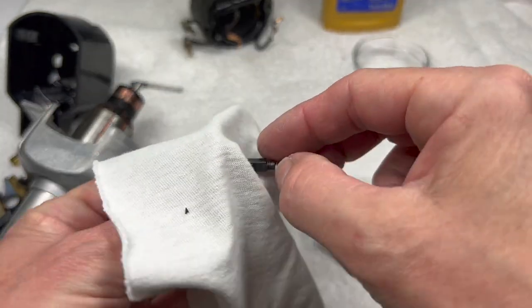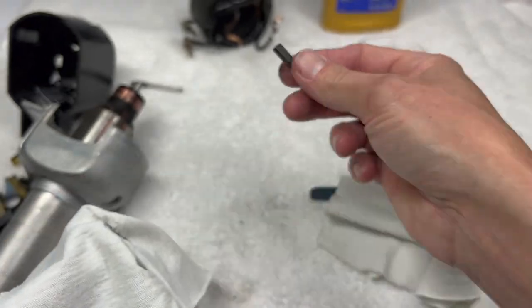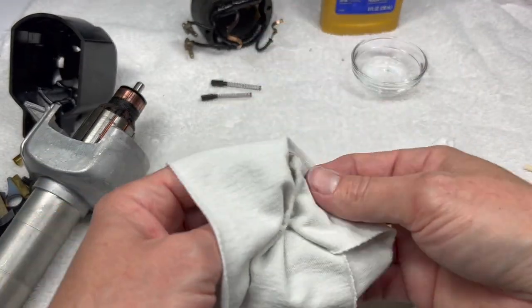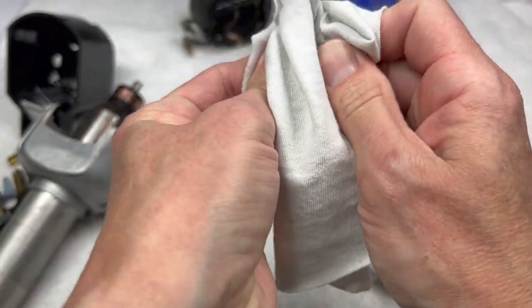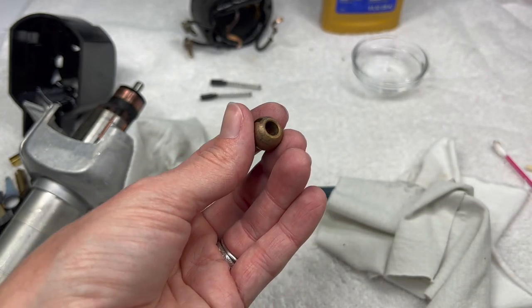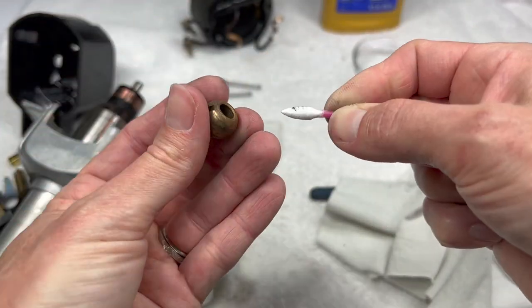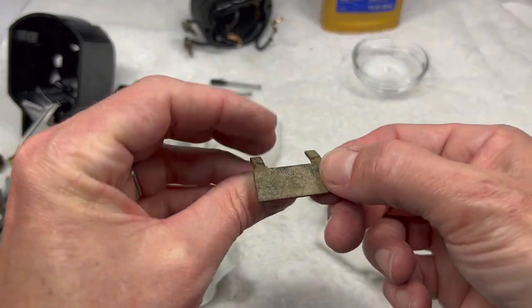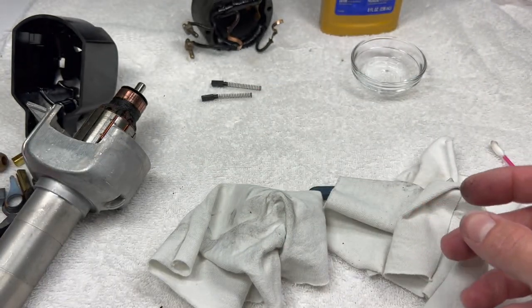Look at the difference — it's amazing. Now do the brushes: no cleaners, just give them a nice wipe. There might be a little oil or residue — just wipe them off, that's all. Do not add any oils or detergents to the brushes themselves. The ball bearing: same thing — I really don't recommend putting cleaner on it, just wiping it off well because the metal is porous. If you add cleaner you could inject it into the bearing. The only thing it gets is grease via a Q-tip down the center. The insulator as well — just wipe it off with a rag, make sure there's no oil on it.